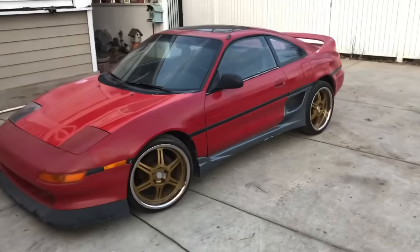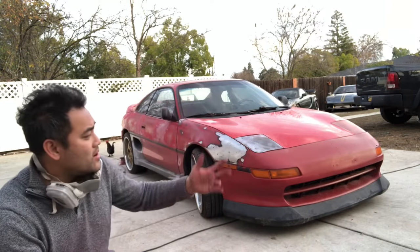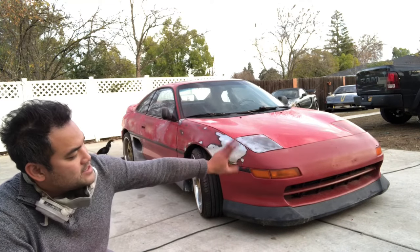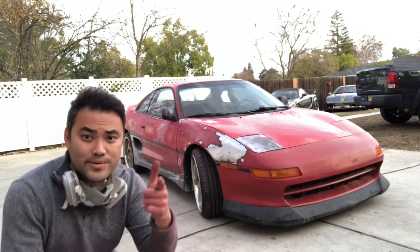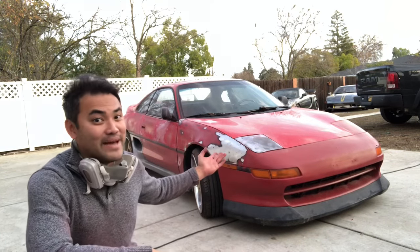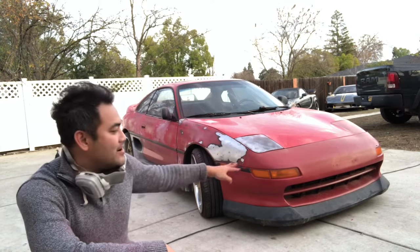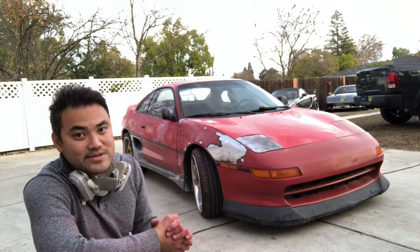That's it for this video. I finished sanding pretty much the whole car — I still need to do more on the hood and I'll do some bondo work on the holes in the front end. In part two I'll pull the car into the garage and start wrapping. It looks pretty bad right now — that front fender is toast. I'm going to tape off the lights and spray a little primer since there's so much bare metal. Thanks for watching — catch me on the next episode where we wrap this car!